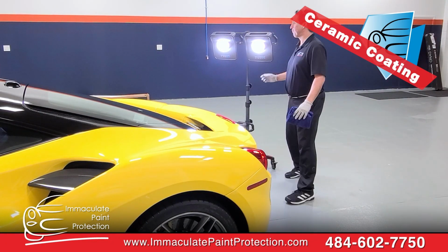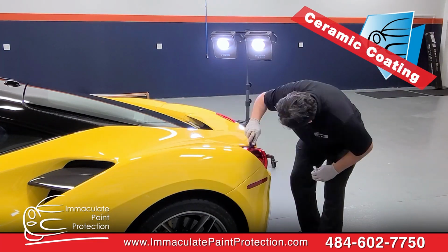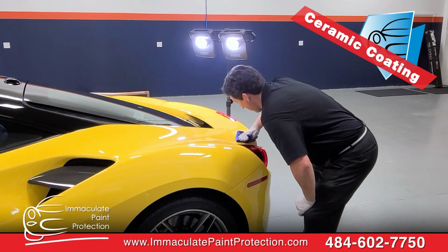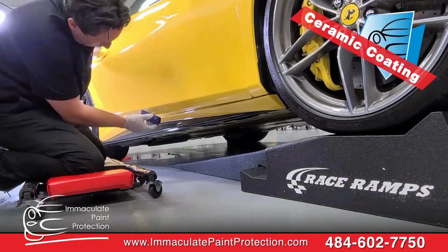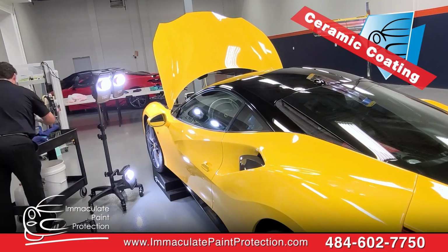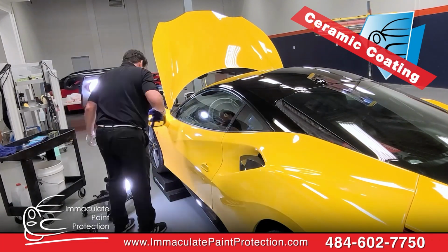We did Gyeon Flash on the black painted roof, A-pillar, the back end spoilerish area, right where the engine is, and the 2 doors. So Gyeon Flash is done. We have the infrared lamp up and running now. We'll run that for about 15 minutes per section. That'll help cure it off a little bit.